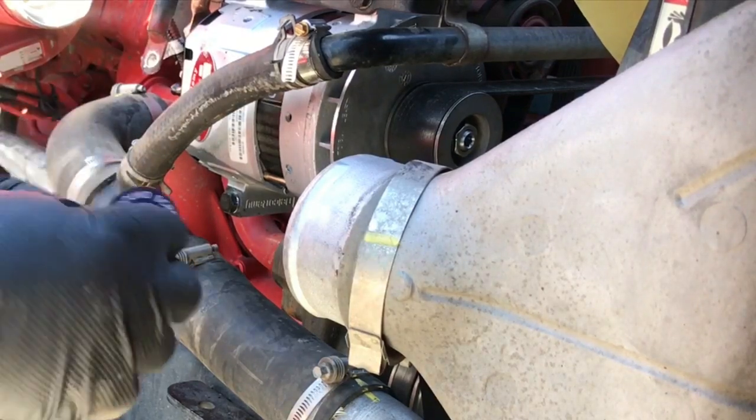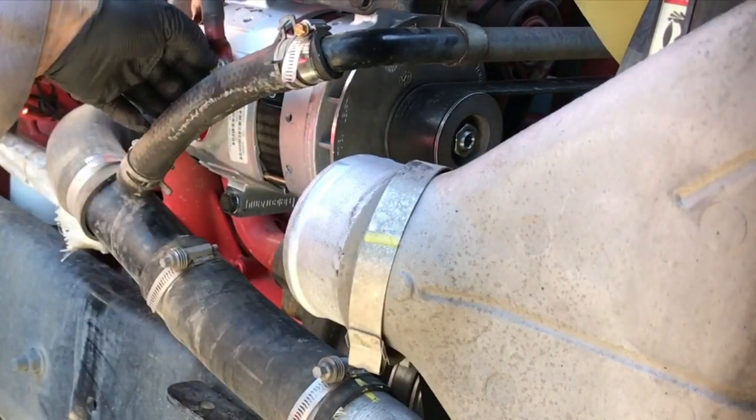On this paper that comes with the alternator, make sure you remove it — it tells you right there — because you want to get a good contact for ground.